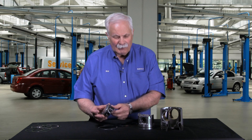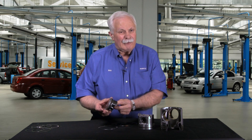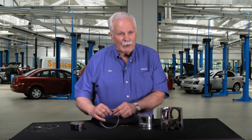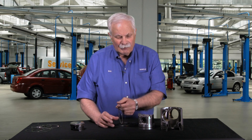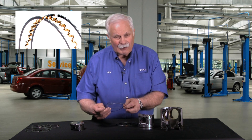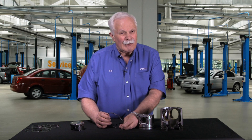The light-duty automotive, of course — little engines like this Chevy Cruze that I've talked about before — have a three-ring lineup. We've talked extensively about the two compression rings. We haven't said much about the oil ring, and on this Chevy Cruze, as is true with virtually every light-duty gasoline vehicle, the oil rings are what we call a three-piece design. You can see in the close-up here two flat rails and a waffled expander in the center — three-piece design, light-duty gasoline, almost 100% out there.